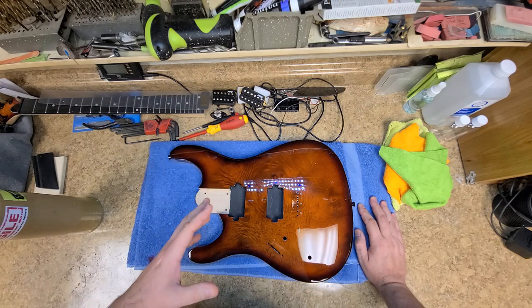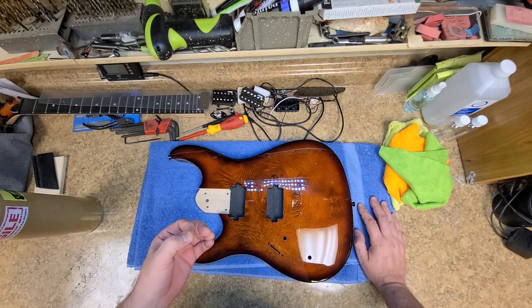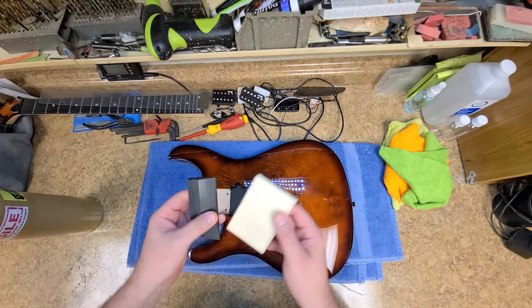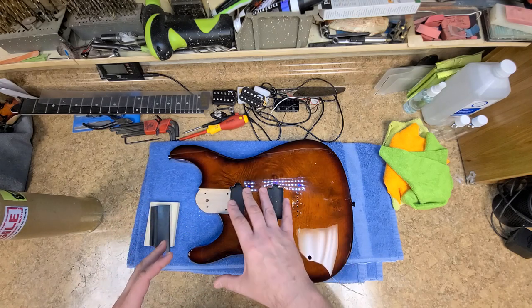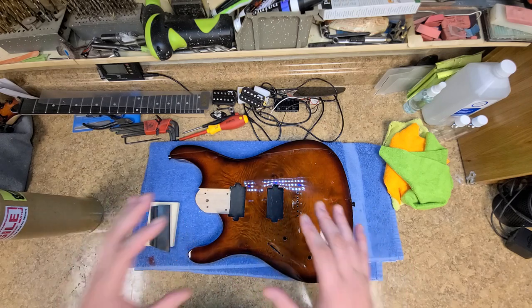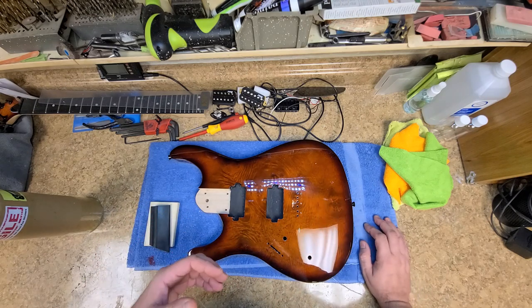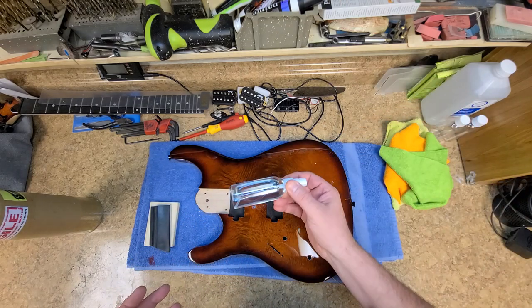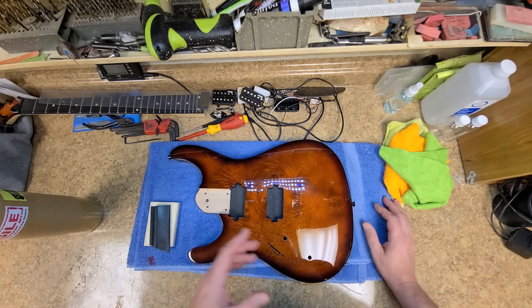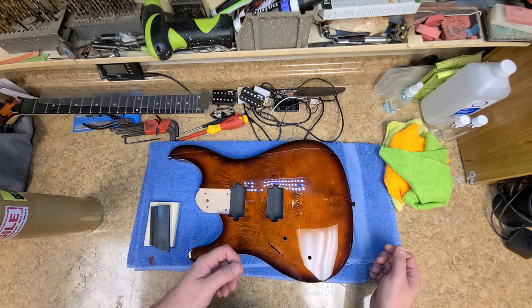Normally when you're putting a vinyl decal on a vehicle, some type of graphics, you will use soapy water, and then you will use your application tools to squeegee out the water and any bubbles under your graphics. Well, in this case, you don't do that. I found out the hard way. For the graphic I put on here, I used a mixture of soapy water in a spray container, sprayed the body real lightly, applied my decal, and squeegeed out the water, and it didn't stick, it came right off.